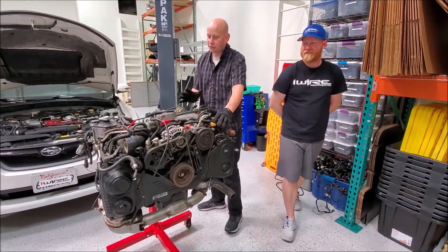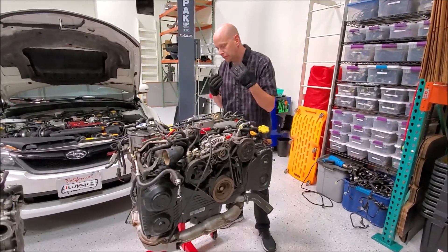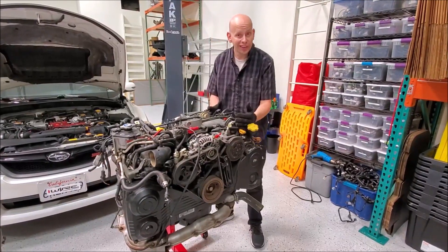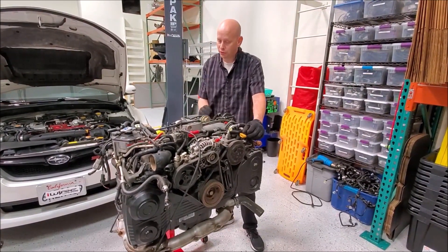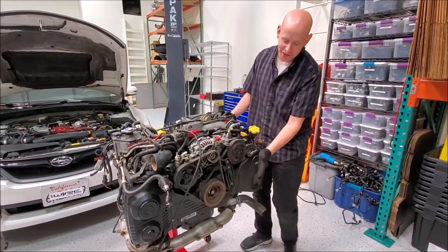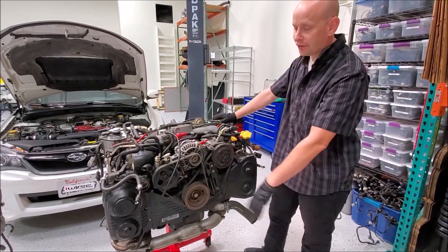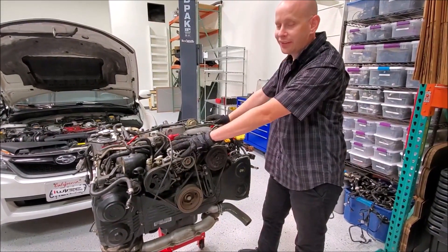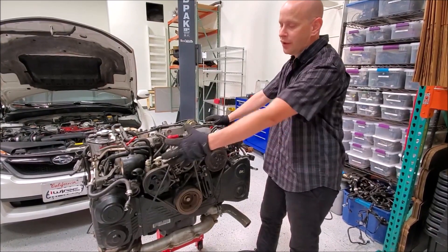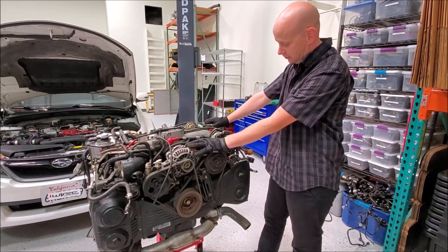So quickly, you want to do a basic visual inspection of the engine. Make sure, when you're looking at the block, there are no cracks. You also want to check for oil leaks — if there are major oil leaks, you'll want to address them first. I also suggest checking belts: timing belts, accessory belts. Sometimes they come with the accessories, sometimes they don't. I always suggest, if possible, to move the accessories your vehicle came with onto the donor engine.